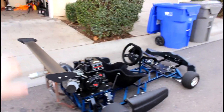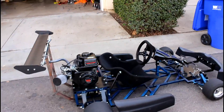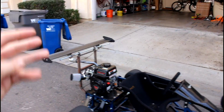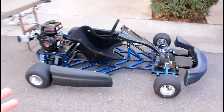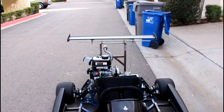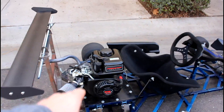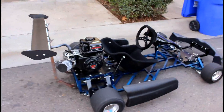Before I end this video, I'll talk about the wing and how it's doing in another video. But just in regards to the go-kart engine, the carb jet performance, and how it feels — this thing feels so much more alive. I don't know how well it comes across on camera, but this thing just rips now. It's amazing how much those three little simple mods can do to really liven up the feel of the go-kart. You're pretty much on the ground, so it feels like you're going 100 miles an hour. I'm really happy with the Stage 1 kit. I actually haven't even finished all of the mods — I still have to do the new valve springs. Since the governor is removed, it'll prevent valve float if I put those heavier valve springs on. So that's going to be another video: how to install those and how to re-lash those once you get them installed.